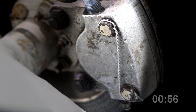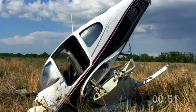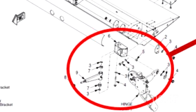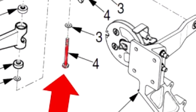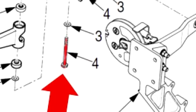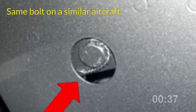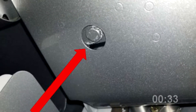Safety wire is used to keep a bolt from backing out due to vibration. In May 2018, a Cirrus crash landed just after takeoff in Texas. The pilot survived to tell investigators that he was having an uncontrollable left roll. Inspection of the wreckage revealed that the left aileron actuator arm and attach bolt were missing. The remaining actuator bolt was missing its required safety wire. This bolt is easily visible during a pre-flight walk-around inspection.